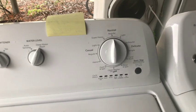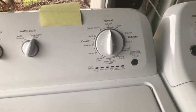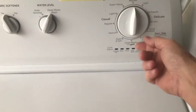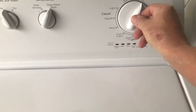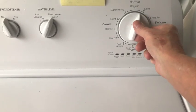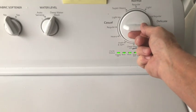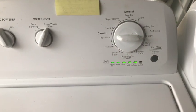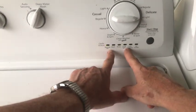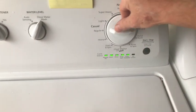For this demonstration we're going to put it in agitate mode. This is how you enter the service diagnostic mode. I like to start on twelve o'clock, so you turn it counter-clockwise and stop on the twelve o'clock. Then one, two, three clockwise. One counter-clockwise. And one back to the three o'clock position, and all the LEDs will be flashing. From this point you want to go clockwise.